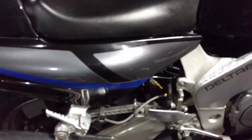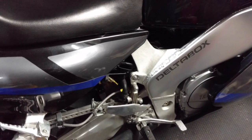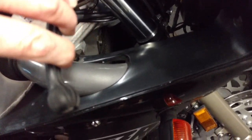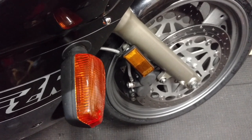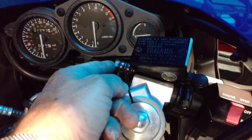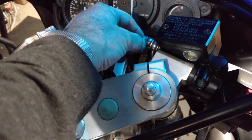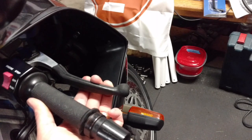The interesting bit was trying to get the brakes bled. I found a couple different videos online. It wasn't that hard to get fluid pushed through and out through the calipers. Every time I'd give this a few squeezes, then open the bleeder valve, and I'd get fluid coming out. The problem was getting that last bit of air out. In the front, I had to loosen up this bolt right here with a rag around it. I actually had my wife squeeze the handle, and when she did that I'd crack this open a little bit — and that's when I saw the bubbles come out. I did that a few times, got all the bubbles out, and got a firm handle. The brakes work great now.